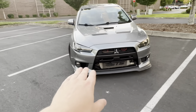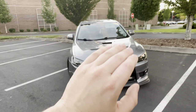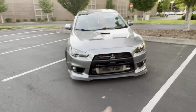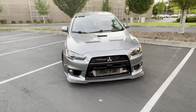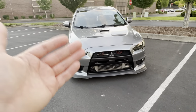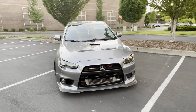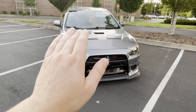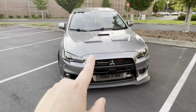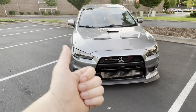For street use I would recommend Stage 2s — they can still make plenty of power. You'll make 700, 800, 900, potentially even a thousand horsepower out of those cams. The S3s are even more — they're more designed for super high revving 10,000 RPM drag racing kind of cars. So it's your preference, but I recommend the Stage 2 variations.